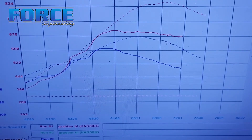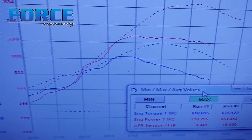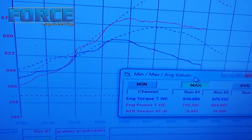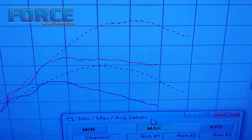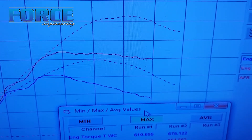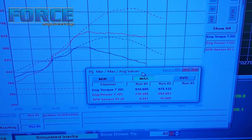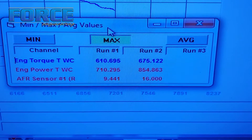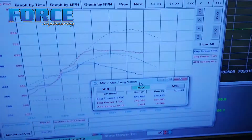Check out the difference in the curve — you can see the car comes up fairly similar, though I'm not sure what RPM I was starting to pull at previously. Just the shape of the curve is quite a bit different, as you can see the converter working. That gives you an idea of what the RPM graph looks like out to 7500, and there are the power number differences.